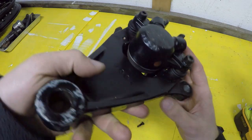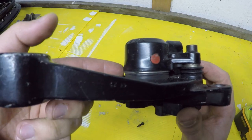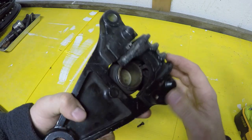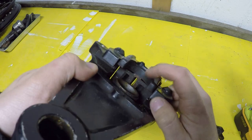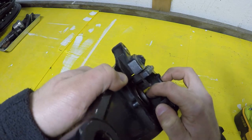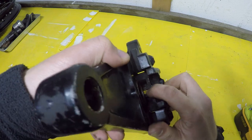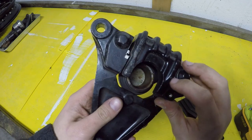One thing I wanted to point out was this clip right in here — I wanted to double check where it actually goes. It sort of goes over the rubber piece and sits up against the actual caliper. You can see these retaining clips in here; these are actually to keep the pads from rattling. A lot of these calipers don't have them — either they've gone missing or people just forget about them. There are two sets: one that sits right in here, and two on each side that hold the pad in place.